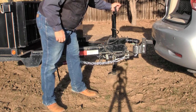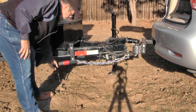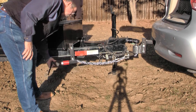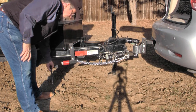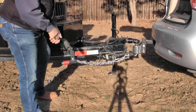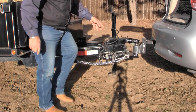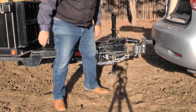When you unhook this, use your jack, put a little pressure on it, lift some of the weight off the trailer tongue, then use the socket that comes with the Anderson hitch and loosen up the neoprene spring where the bolt goes through. You loosen them up on both sides, and now you're all set. All you have to do is come up here and pull this pin out, and drop the chain spreader off the ball.